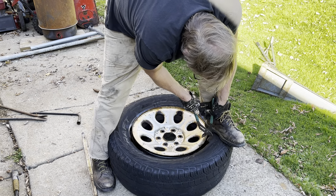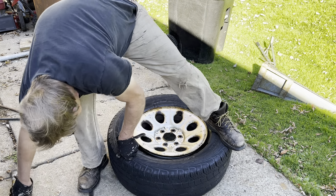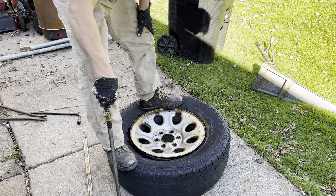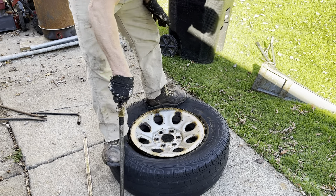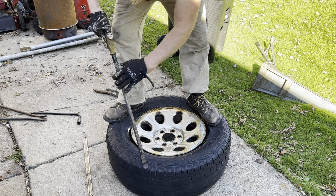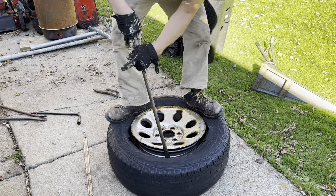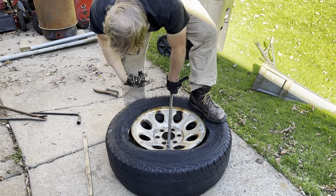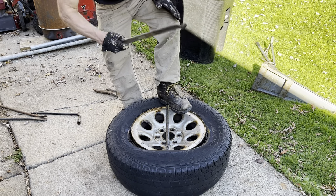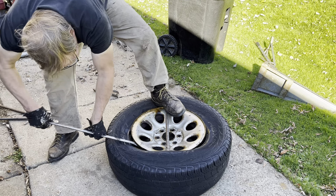Get that weight out of the way - it ain't going to be in the way marginally. Come on, I put my feet kind of like a V and then get on the other side here. Then you just gotta keep working that around with another tire iron. Put your foot down here so it doesn't flop up and break your jaws or your teeth or mess up your pretty face.